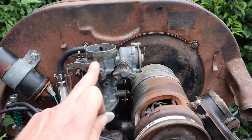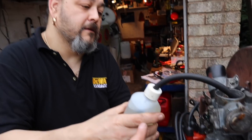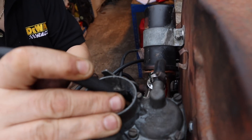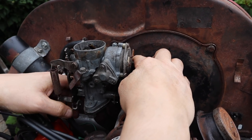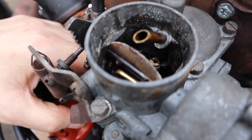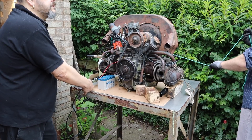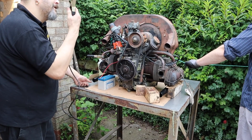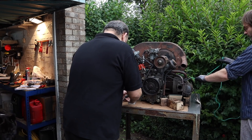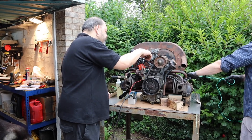We think we've improved the pump jet system. Ian's made a pretty nifty squeezy bottle — that's a must-have inspired idea. We're filling the float bowl up now — it's just starting to drip a bit, so I think we've filled her. That will start her now. This will start the engine. Shall we fire her up? So have we poured fuel down the carb? Fuel in the finger and we've pumped it. Would you like me to connect the earth? I'll wait until you've started the engine — it's warm and running. I think we're going to need some more fuel in that carburetor. No, it's feeding. Alright, get ready.